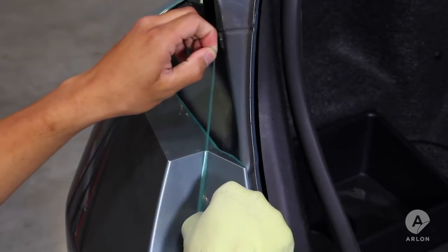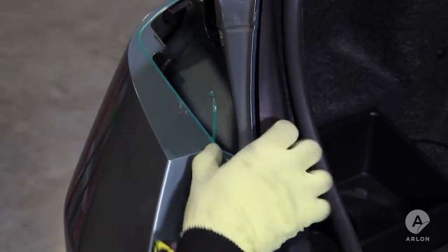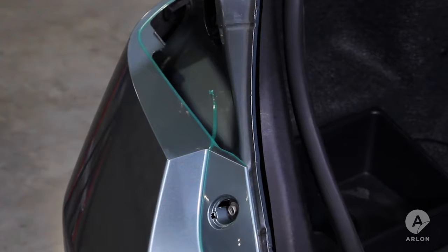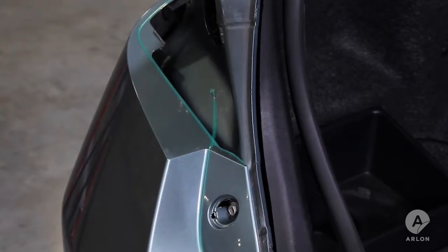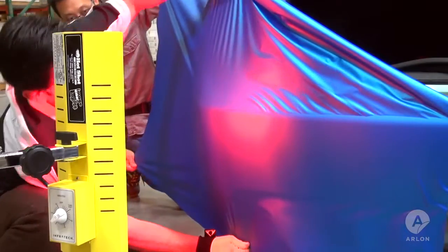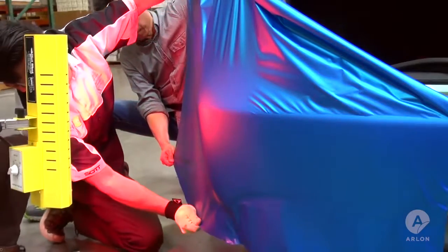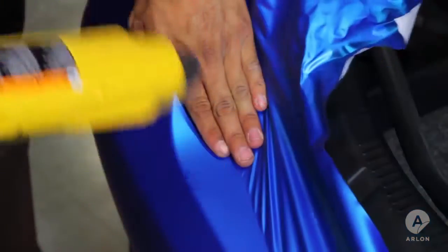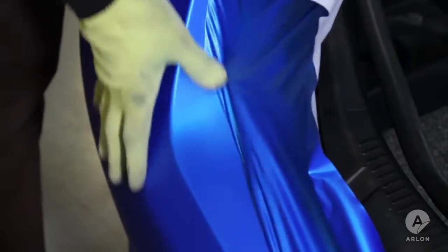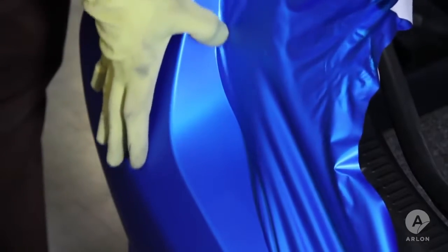To wrap three-sided corners right, we have to make sure that there is no tension and it is aesthetically pleasing to your customer. First, lay down knifeless tape on the edge for trimming and overlays. Then, wrap the two sides using the broad stretch and expanded pocket technique. The detailed breakdown of each technique is available in wrapitright.com under how-to videos.